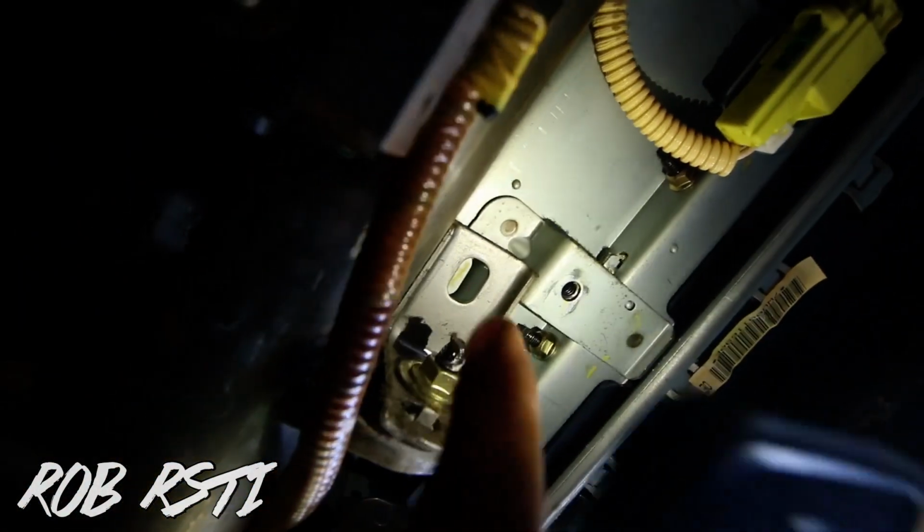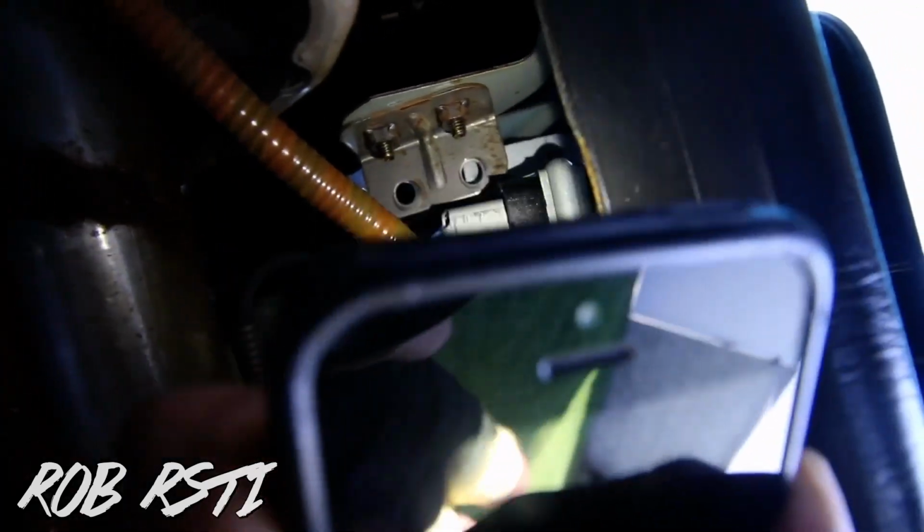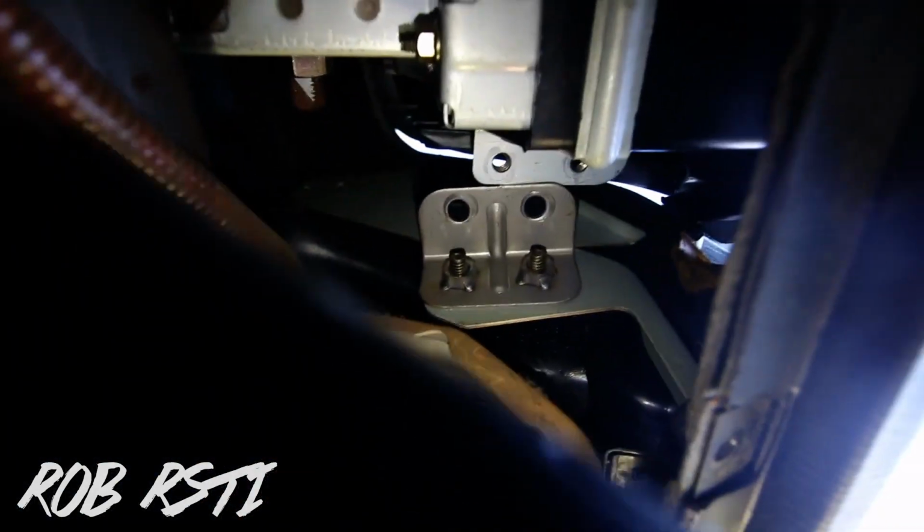Okay guys, there's gonna be a bolt right here. For the 10s, one right here, one over there, another one right there, and then the 4 8s are gonna be right there, 2 over there, and then 2 right there. And then the airbag system can just pop off, and then there's this connection right there. This might not be one, but I think it's just this one, this connection. It just pops off.